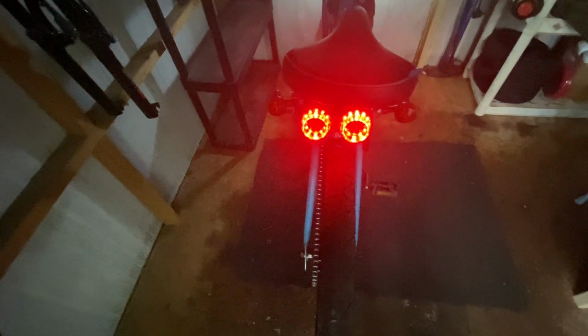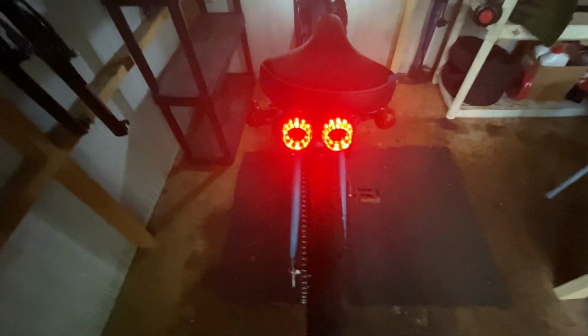If it can move, if it can adjust with the chain and it's straight, then that's all that matters. Yes, this one is kind of dished out at an angle, but that's all mounting related, okay? It's not extreme. It's not like it's about to fall off. So it's good. Where the axle mounts up to the bike is wider than it is up here by the motor.